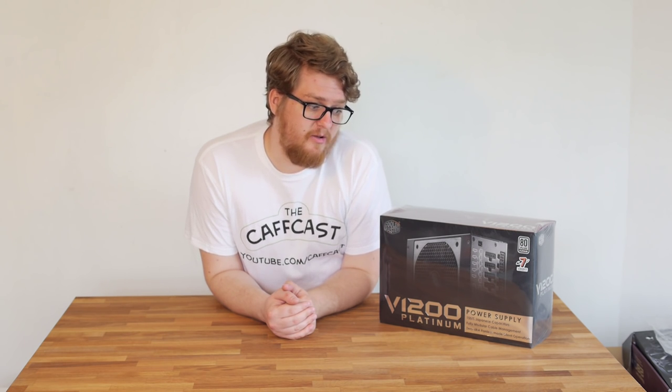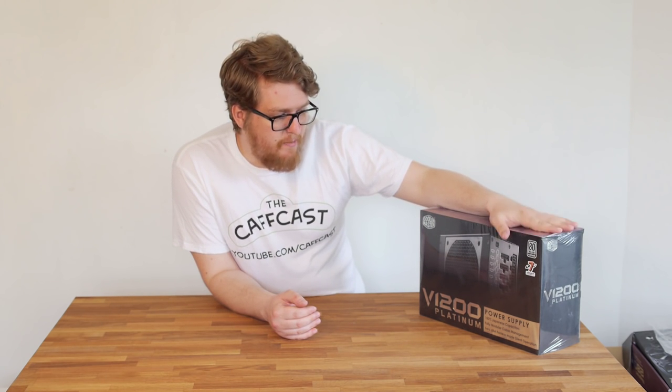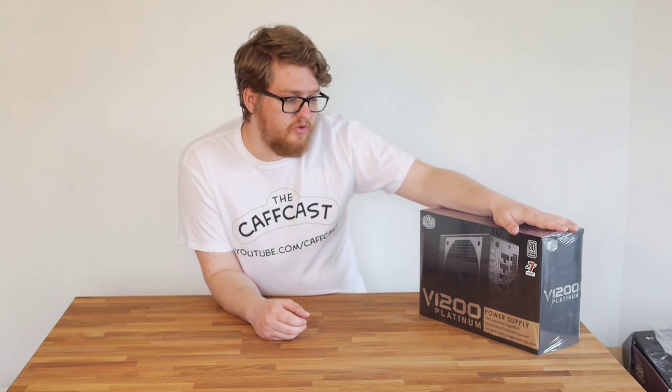Because it's here and I wanted a power supply that had a platinum grade, you would essentially be able to get away with something more in the range of an 800-850 watt power supply, and even that is never going to be fully used. But the cool thing about something like this is that under the 10% threshold, the fan will not kick in. So hopefully that means that when this computer is idle, it is going to be even quieter, which is a significant benefit. It is modular, as you guys can see here, and it has 100% Japanese capacitors, which means they are of a high grade and built to a high efficiency. And obviously we all know that efficiency means reliability, so hopefully we're going to cause no problems with it at all.